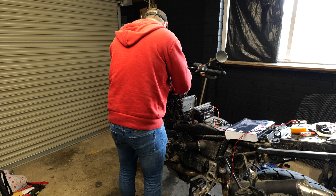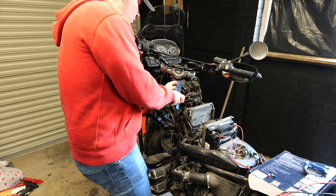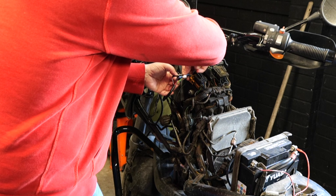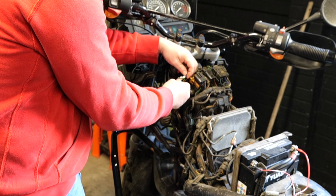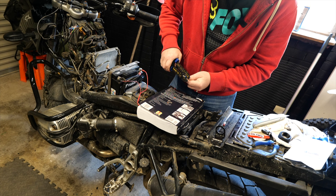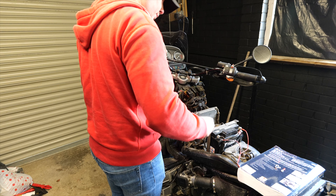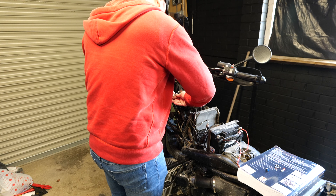With the mount sorted, I make a cut in the purple and grey wires. I clean up the insulation and crimp the new piggyback spade connectors to those cut wires. I've then got to connect the two spade connectors together ready for the new wiring. With that done, I crimped two new connectors to the wiring of the new USB charger, then did a test check to make sure there's power going to the charger itself before fitting the new connectors to the piggyback wires.